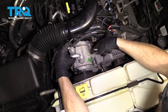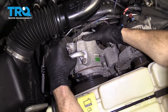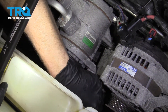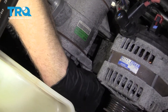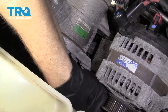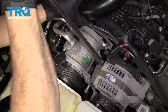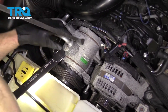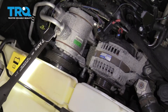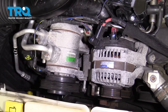We grabbed our long bolt. We're going to get the AC compressor lined up with the bracket here, slide that bolt through, get it started, and then move on to starting the other bolts before we tighten any of them down. This is the longest bolt and it goes here. Feels like the bolt went right in but I don't feel it grabbing on the backside, so we'll have to lift up on the backside or move it around a little bit. Just going to move the compressor around and see if I can get that bolt lined up. Feels like it got snug — let's get that 15 on there. Got a few good threads on that.